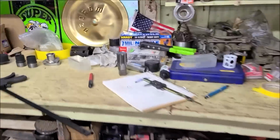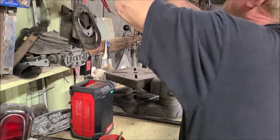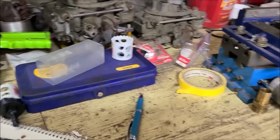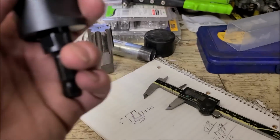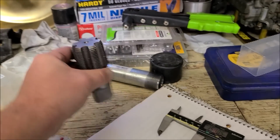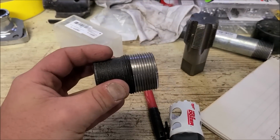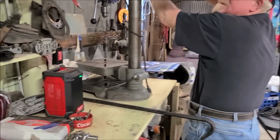All right, and here's your further update on the valve cover excursion. Okay, all the vise and stuff is removed from the drill press. We're gonna find a way to clamp the valve cover down to that so Dad can use the 1.5 inch hole saw, which will be just about perfect. We have done measuring upon measuring to make sure we get the right depth of thread from this pipe tap to get these sunk in exactly how far we want. Dad's got the fairly fun job because he just gets to use this.